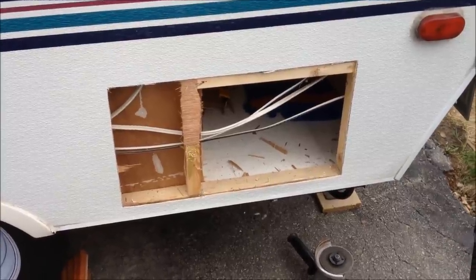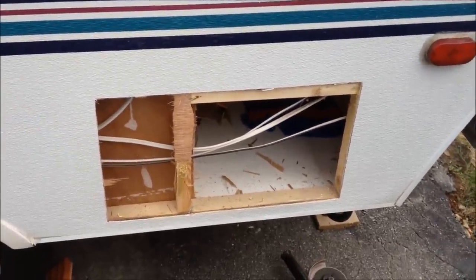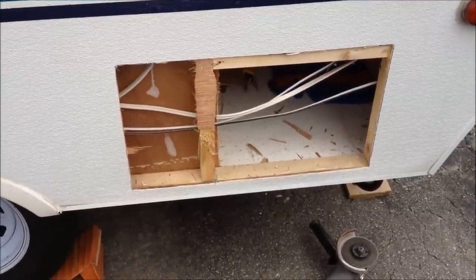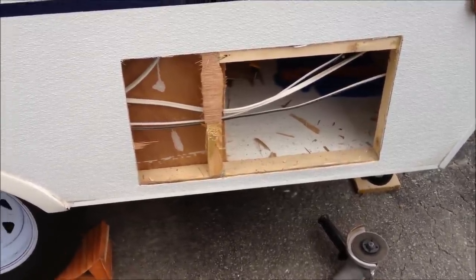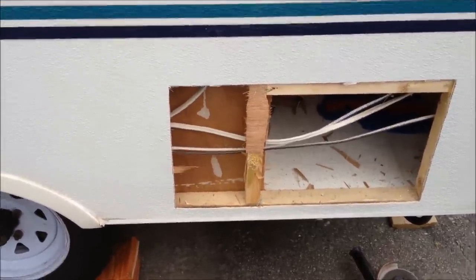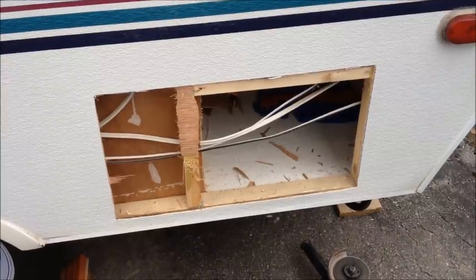I was able to cut the hole for the door. I used my angle grinder to get through the vinyl a little bit quicker, and then just a utility knife to cut through the very thin pre-finished wood that they put on for the paneling. As you can see right now, the opening is fit for the actual door. However, the actual compartment under the seat is smaller than the overall size — there's a beam in the way. So what I'm going to be doing is restructuring the framing of the trailer, removing this beam to be able to fit the door in properly. By doing this, I'll have access to the storage compartment under the bench seat, as well as being able to get into the trailer itself when the door is open.